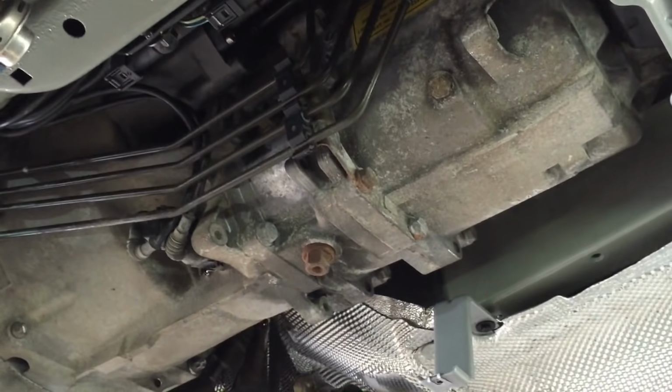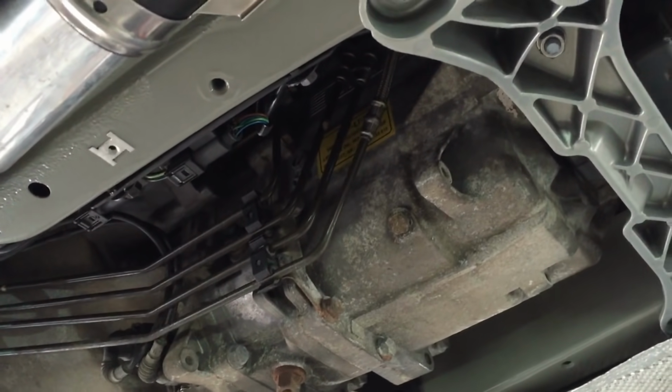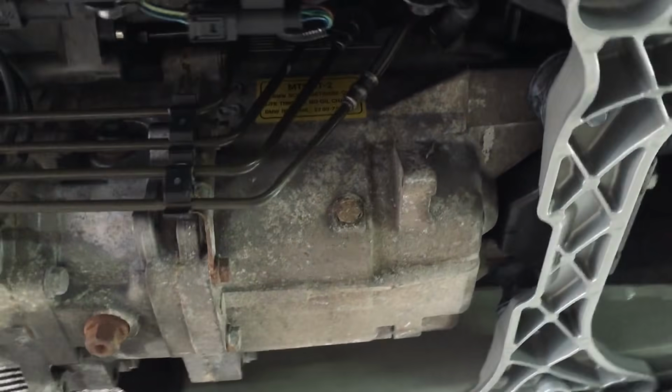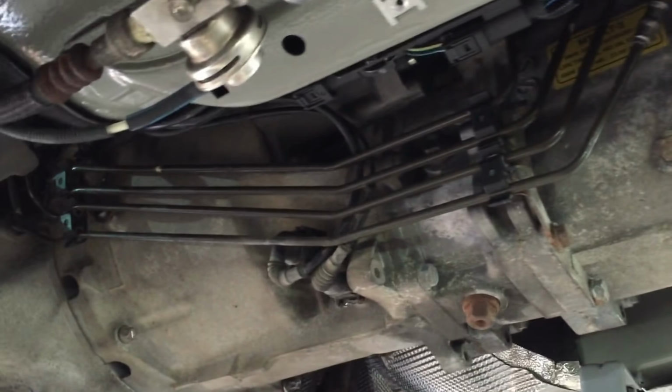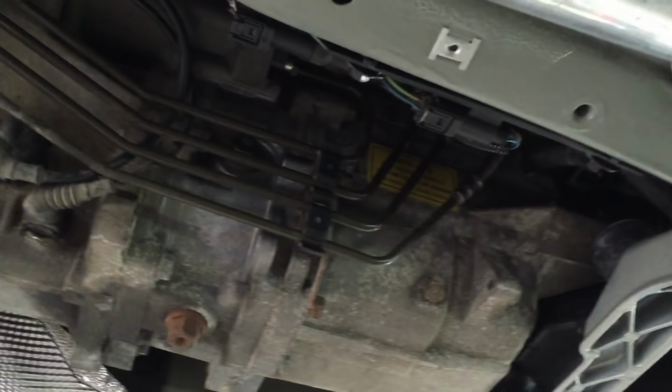Now the prop shaft's installed. So since then the gearbox is in, so you do the rear main oil seal, original flywheel and clutch, and a new release bearing and ball pin and spring clip inside. The engine sump and the engine component itself and the gearbox are the only things that haven't been painted or powder coated. They've been dusted off, but that's not within this job spec.